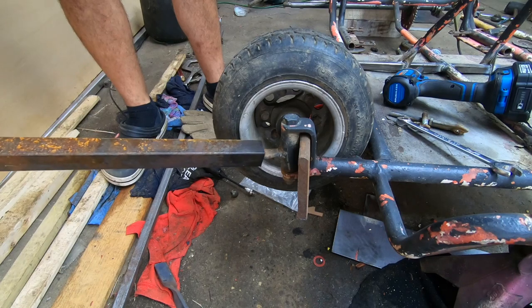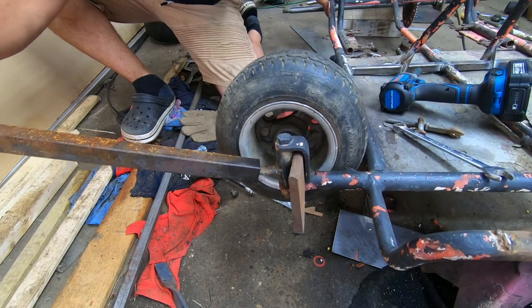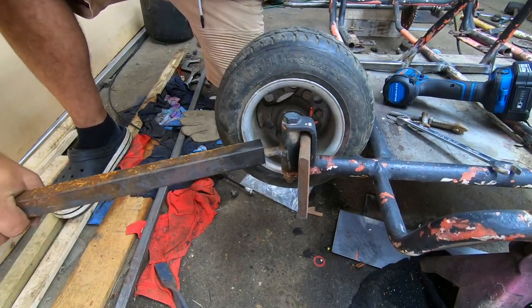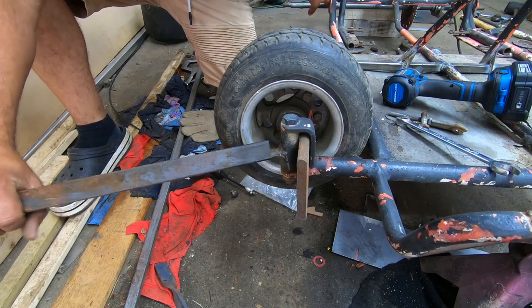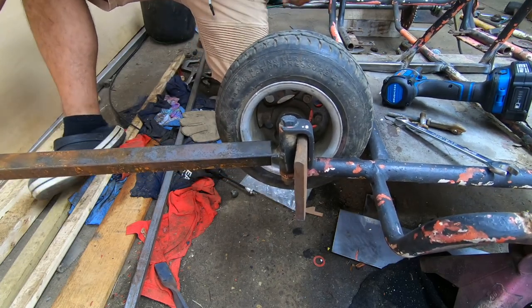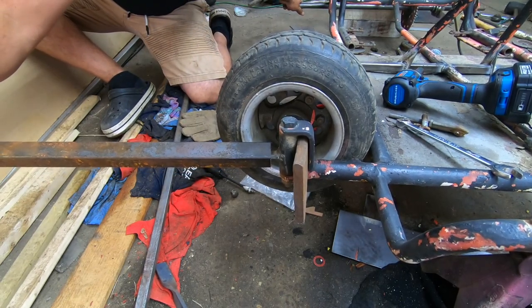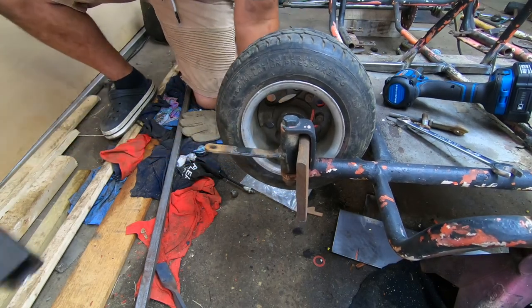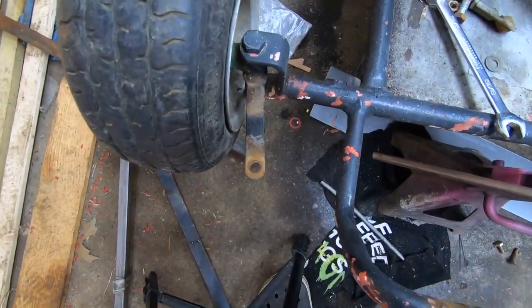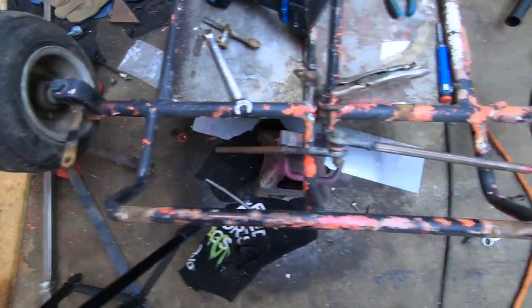I got a piece of scrap steel in here so that way the spindle can't mess up the wheel. Got a big old cheater bar here and we'll see if we can straighten this out. It looks like it's just bending it upwards — I'll bend it back down. The go-kart chassis kinda wants to twist on me, so I'm trying to hold the chassis while bending. Alright, that's not working — worked a little bit. I was able to do some grunting and a little help from my little llama down there, and I was able to straighten it out fairly decent.